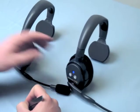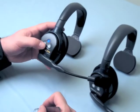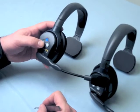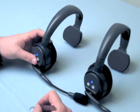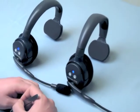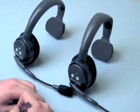On the remote headset, press the volume down arrow 3 times and then press and hold volume up. The LED should turn solid. Release the button. The two headsets — master and remote LED — will both turn solid when they're linked.